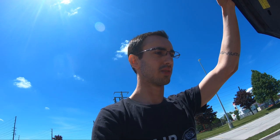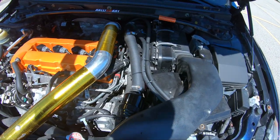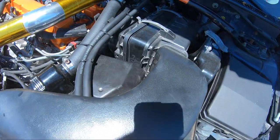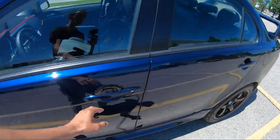The stuff you can't see: it has a full Ultimate Racing turbo-back exhaust, test pipe, no cat. It still has mufflers on it because I don't like it being too loud. It is turbo swapped with a stock-frame turbo with a larger wheel installed inside, on the 18G TD04 setup. I have the Tial QRJ blow-off valve, or bypass valve. As far as intake goes, it's a stock intake with a K&N drop-in filter, which is really all I need for the power I'm pushing. I'm just using a stock lower Evo X intercooler pipe, and the intercooler is slightly bigger than the Evo X stock unit.